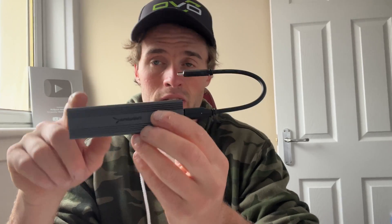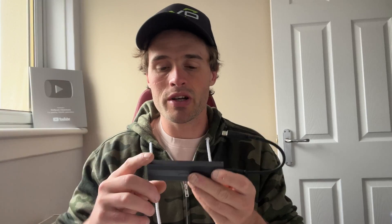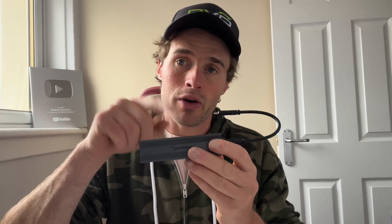I don't generally store all my footage on here — the SSD hard drive is great for editing from. If you've ever done any editing before, you'll know that editing from a disk drive is generally a lot slower. Disk drives are bigger in space and cheaper to buy, but they're not great for editing. SSDs are a lot faster if you've got 1080p, 4K, and above footage. Once you've edited your video on this, I would then transfer it to another hard drive to store if you want to keep your footage.